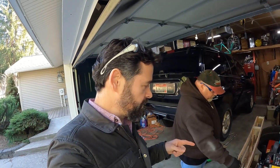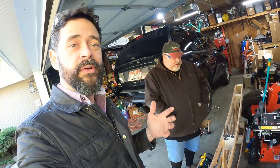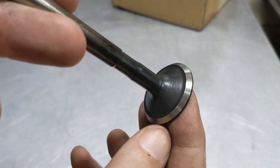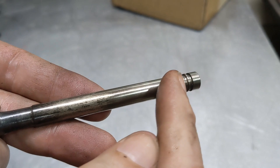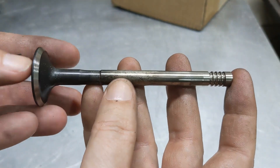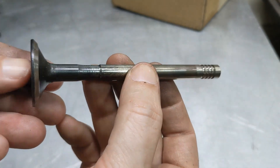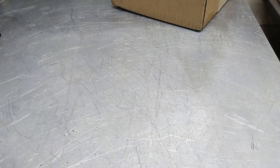So that is the basics of grinding a valve — that is awesome. Now we've got some more of these to do, but I just want to point out something, Chris: when you see this, you're going to see this one's obviously crooked. See how that's bent? But we were saying, don't worry, we'll just grind that straight — yeah, it'll be ground perfectly straight. Got these valves back from Dr. Tork. Take a look at that — that's a really nice face, still plenty of margin left. I dropped it into a guide to make sure it's smooth and fits. Sometimes they mushroom out up here, and sometimes they can get bent. But this is what they look like when they're done — ready to drop in and reassemble the head. That's all there is to it. Thanks for watching.